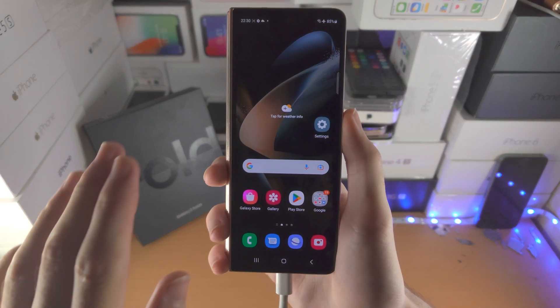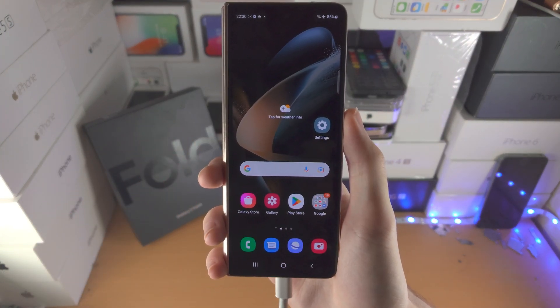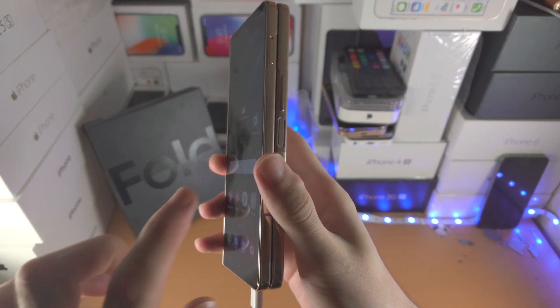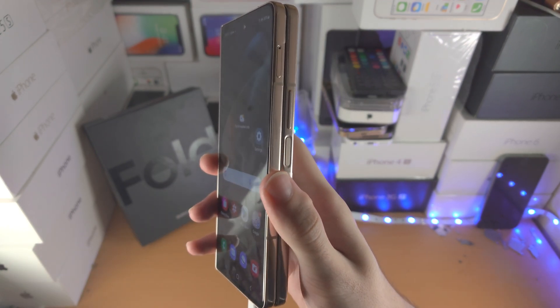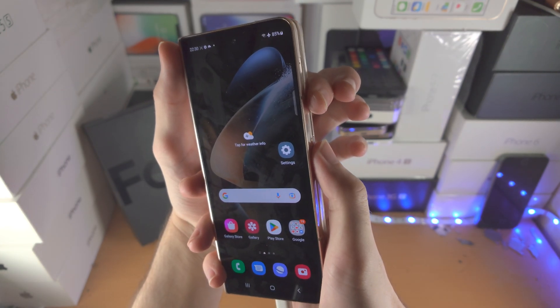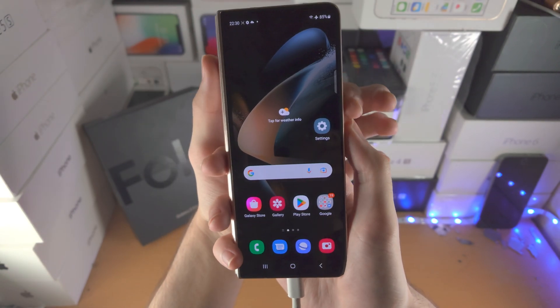Welcome everyone! Let's place our Samsung Galaxy Z Fold 4 into recovery mode. To do this, you're going to press and hold the power and volume down key together for 10 seconds, then press and hold power and volume up key until you enter recovery mode.